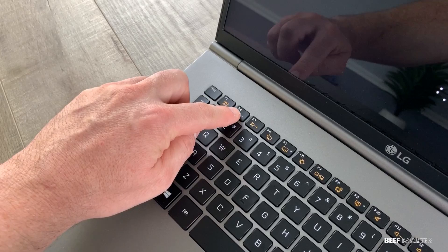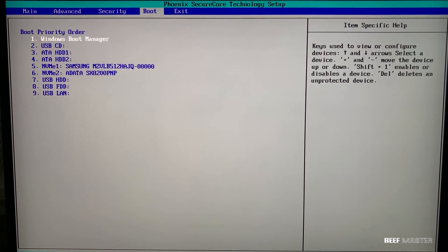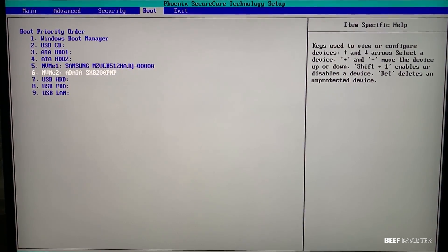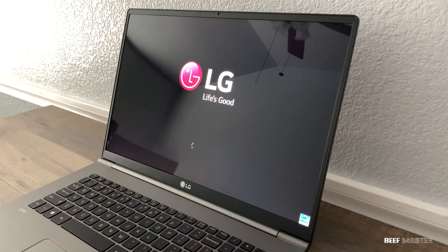Let's boot it up into the BIOS. The first time you turn it on, it's going to recognize the new memory, so you need to hit F2 to boot into the BIOS. If you simply want to add additional memory and keep your Samsung as the boot drive, you can ignore this step and let the computer boot up normally. If you want to boot from the new hard drive, follow these BIOS steps. Once in this screen, scroll over to the boot menu — it shows the boot priority order. Number five is the Samsung and number six is the new hard drive we put in. If you wanted to use the new hard drive to boot from, flip the order by pushing the arrow keys; however, you would need to have Windows installed on it first. This is intended as a simple overview of how the BIOS works. Once done, scroll over to exit and hit yes to save changes. The computer will take a second to boot up as it recognizes the new drive.